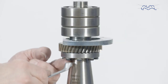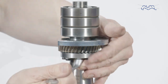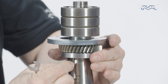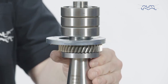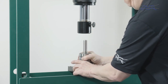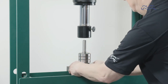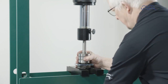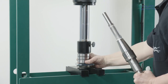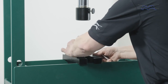Remove the bolts from the timing gear clamp plate. Move the drive shaft to a hydraulic press and remove the gear and bearings from the drive shaft. Then press the gear and the bearings out of the auxiliary shaft using the hydraulic press.